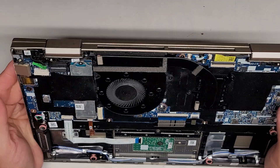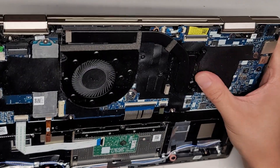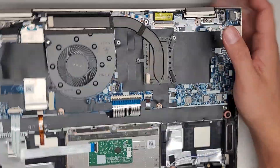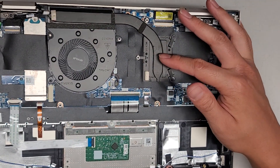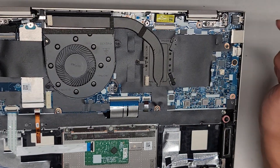So that should be good — much more than 15 seconds. There's no replaceable RAM here — it's soldered to the motherboard. Pretty sure it's underneath this metal plate covered by that plastic. The CPU is soldered to the motherboard as well. If you undo the heat sink, you do need to redo the thermal paste, so keep that in mind.